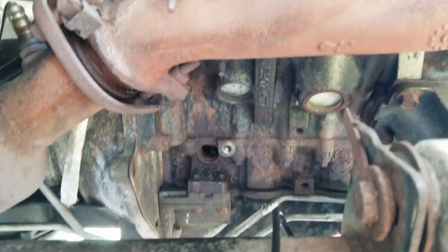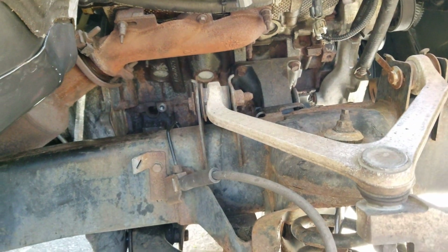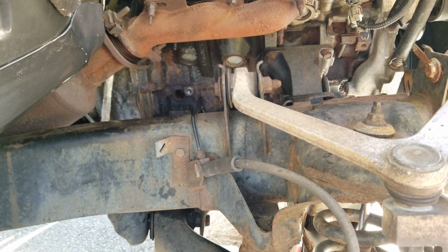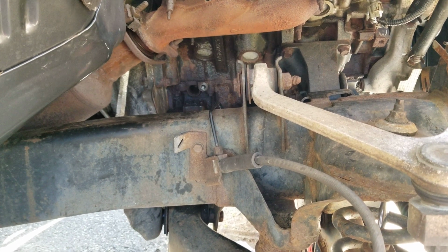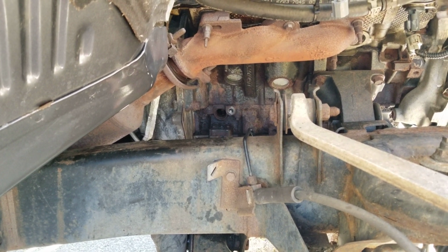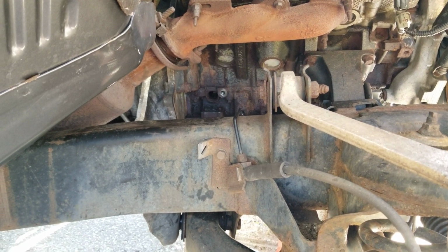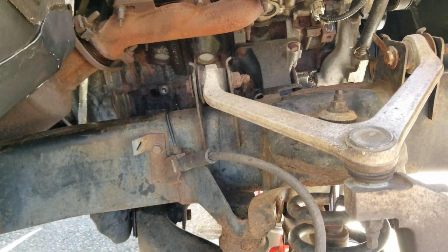I really wanted to share this with you guys because there's not a whole lot on YouTube on how to get a stuck or broken crankshaft position sensor out after it's snapped off. They all rust in there, and before you put that new one in, clean that hole out really good and put dielectric grease or some kind of lubricant, like grease, so it doesn't rust and get stuck in there again. So thanks for watching, guys.